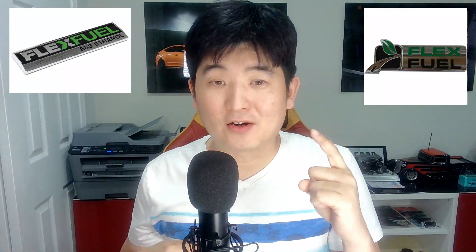How are you going to do that? Are a lot of ECUs able to do this? The answer is no. A lot of the ECUs in your cars do not have the ability to read ethanol fuel content. So if you've seen a lot of the GM vehicles — Chevys and things like that — where on the back of their trunk it will say flex fuel, that means that car from factory has the ability to run E85, and it's able to read the ethanol content and change the ECU tuning accordingly.